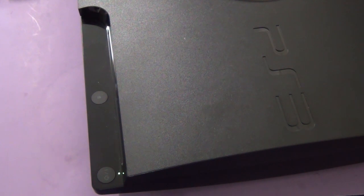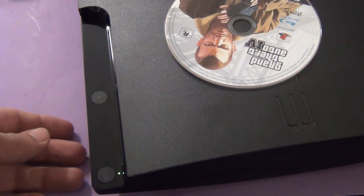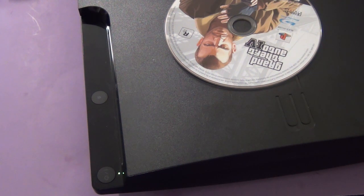Kim Console Repairs. In this video I'll be showing you how to fix a PlayStation 3 slim blu-ray drive. The model we have here is 320 gig CECH-3002B, it's one of the latest ones. The problem is there's a disc stuck in the blu-ray drive. If you try to insert a disc, the eject feed mechanism is blocking it. If you press the eject button, nothing happens. There are a couple of ways to fix it: first, grab another blu-ray drive and replace the PCB; second, we'll be opening up the console, manually taking out the disc, and resetting the gear and the eject feed mechanism. Let's get going.